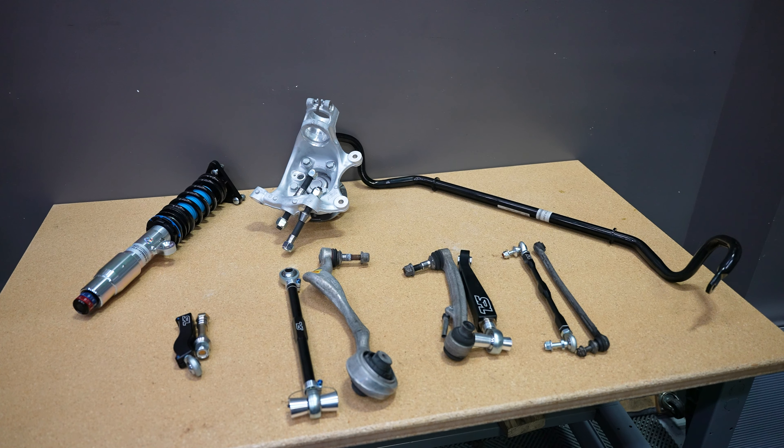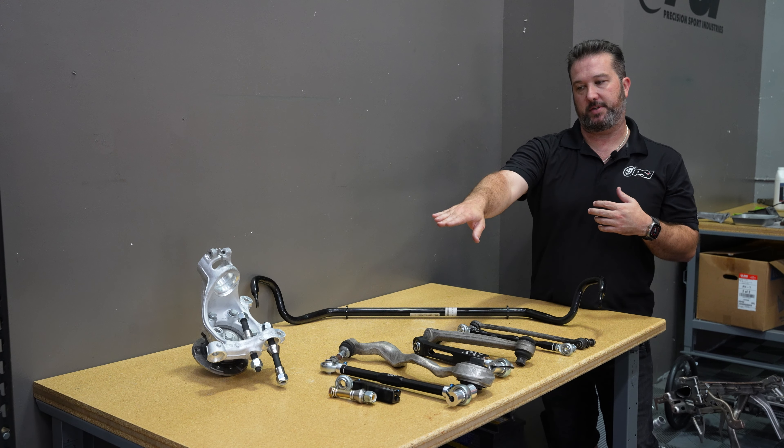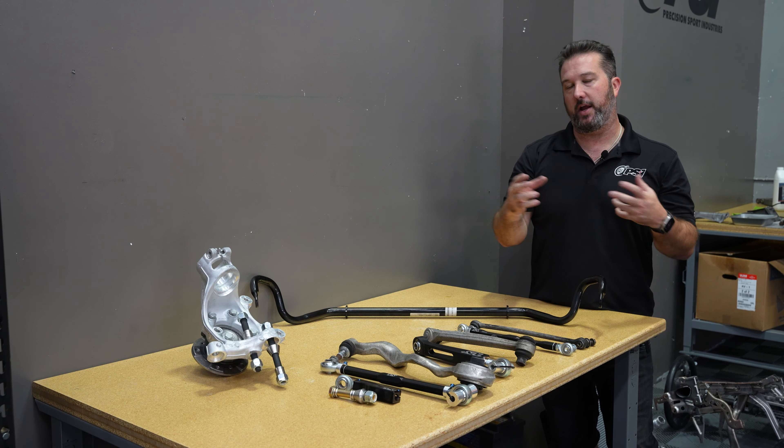Here on the table, we have the SPL arms and the factory arms side by side. The smaller arm is the tie rod end, which has the bump steer correction kit. This is the factory spindle kind of flipped around, and this is the bump steer adjustment that ties in with the tension rod and lower control arm. That's a really important part because once you start adjusting all those components, bump steer comes into play, and all these different adjustments and spacers allow you to eliminate that — a really important part of setting up a car for the track.